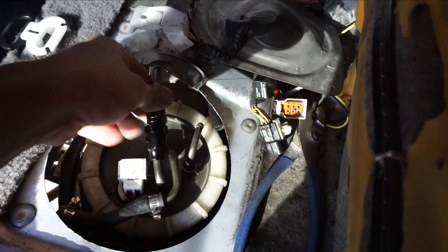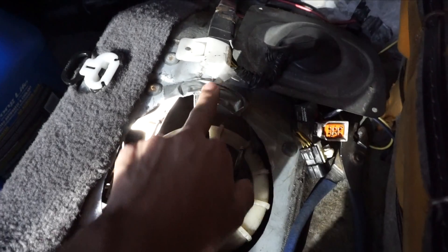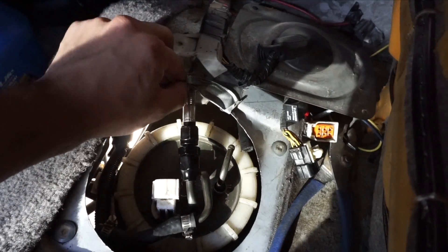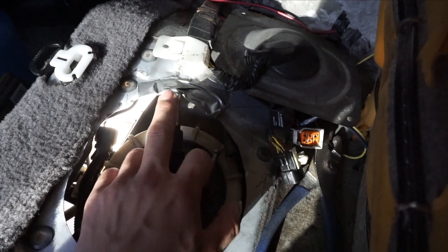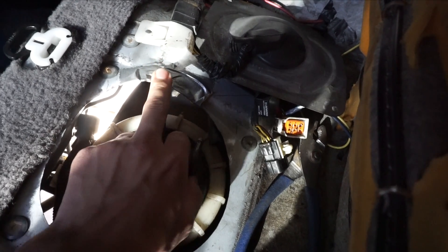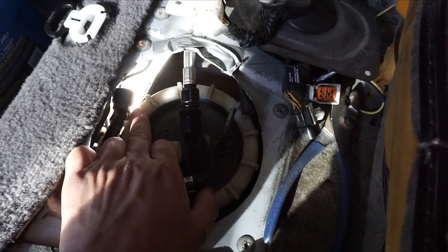I got this line tightened and ready. I did have to cut a little bit of the actual sheet metal right here - that's why I have duct tape, just to protect it from rust. It's at a high angle and I didn't want this stainless steel line rubbing on metal, so I cut a little bit to make sure I had plenty of clearance. Now the fun part - we've got to go under the car and remove the whole stock hard line from the gas tank to the fuel filter.